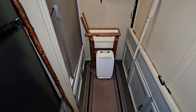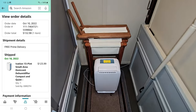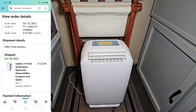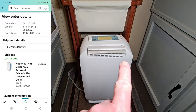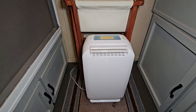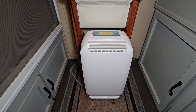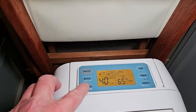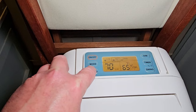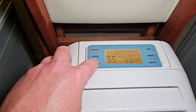This is the little machine that changed my life living in this small space during the cold winter. This is an Ivation desiccant dehumidifier. Just like those canisters or bags you can hang to take moisture out of the air, same principle — except this has a wheel spinning inside with desiccant and it blows warm air over it, constantly having the desiccant release its moisture, constantly renewing itself. You can set the humidity from 35 to 85 with this button. At night when it's cold I set it at 35, it'll bring it down to 35, and then once it gets up to 40 it starts again, or you can just run it continuously.